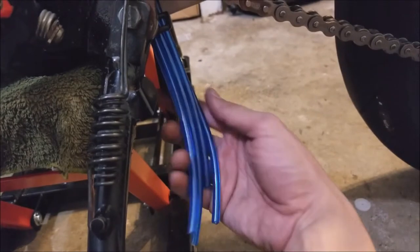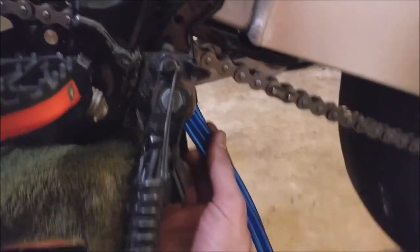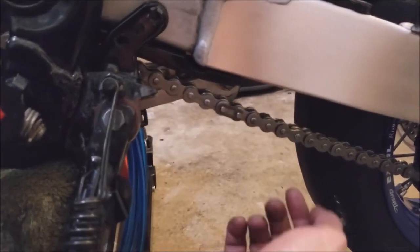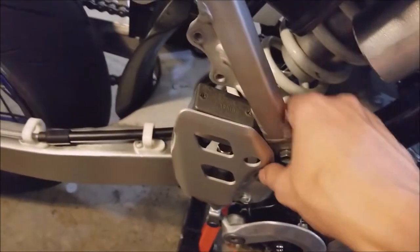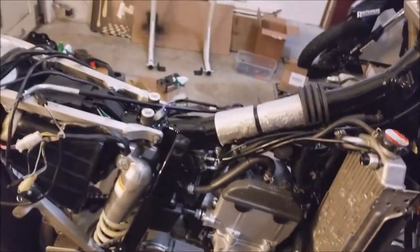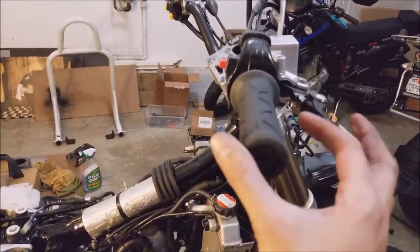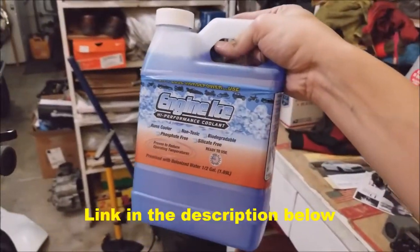The blue lines look good — they complement the bike's blue wheels. The chain looks good, typical OEM gearing. The rear brake lines are now steel braided Galfer brand. This one is kind of touching the spring but hopefully that's not too bad. I have to bleed both brakes because I don't have any brakes right now — there's fluid in there but there are air pockets everywhere. I also have to put coolant in. I'm not sure if I have enough Engine Ice.